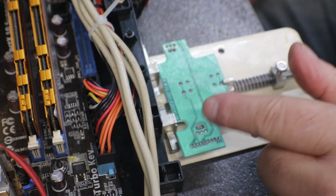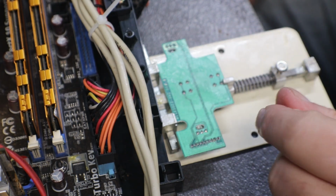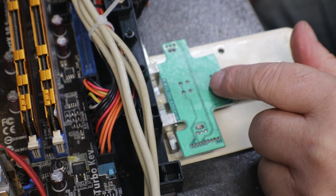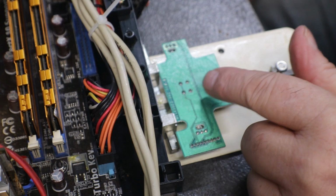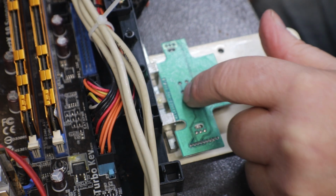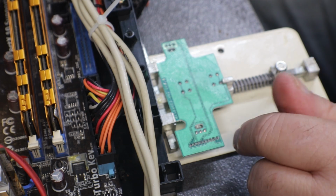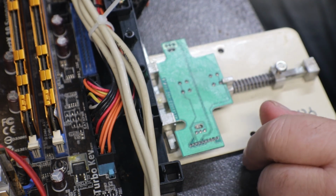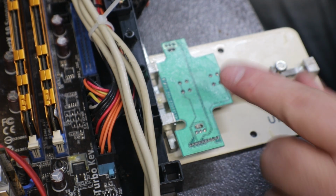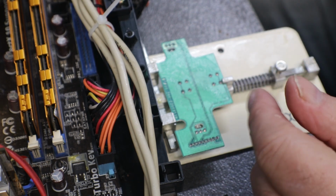Motherboard has floating ground, and so your little board here, the way I had it wired up, will have a ground running all the way through it, which was okay for our light. I'm not too sure about the power switch. It was working, but I'd like to isolate both switches, and then I can solder my wire onto the backside terminal and get that to work. Because I only had like 1.84 volts going to our lights, and I'm kind of wondering if I need to isolate the power switch as well. I don't know if that's what the motherboard produces to light your LEDs.